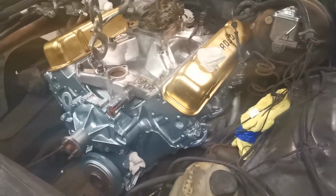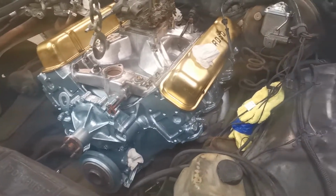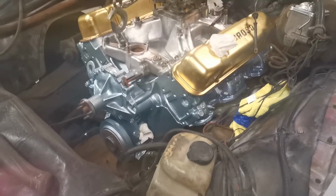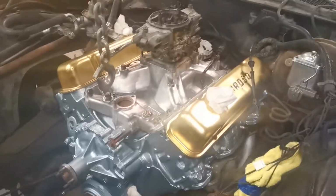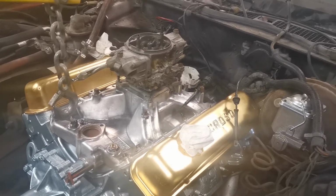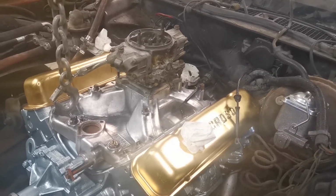It's a 1972 455 HO. It's got TRW L2394 pistons in it. It's got a nice Comp Cams cam, and I'm going to try to leave the Torquer intake on it. I'm going to start it with the 850 there. It runs real good with that carburetor.